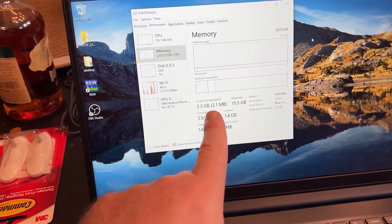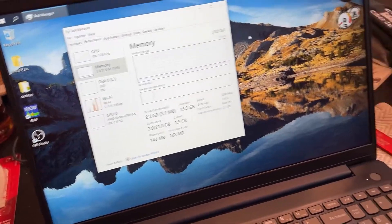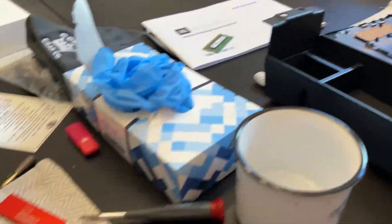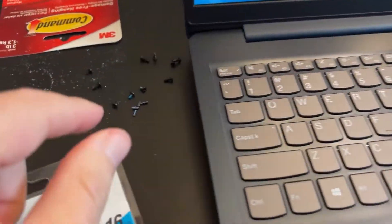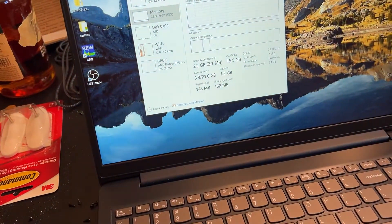With the standard amount I was running out of RAM doing some operations. So all you need to do is unscrew the back panel — there's just a bunch of screws around the perimeter. You don't have to remove any stickers or anything. Use a spudger to go around the edges and pop off the little tab things. Some did break even though I was being very careful, but they're not needed — the screws hold it on absolutely fine.